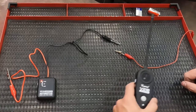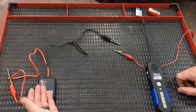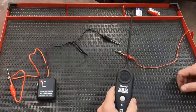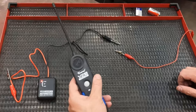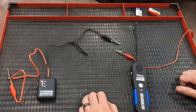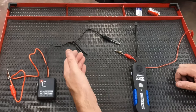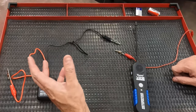This will work through other materials. Say you have a speaker that's not working and one that is working — you can use the known-good circuit to trace the wire in your vehicle so you know where the wire goes. Then go back to the bad circuit and do the same trace, because the wires run together through a wiring loom. When you hear the tone stop, you know that's about where your break is — usually a cut wire, a break at a harness, at a plug where pins come out. Once you find generally where the break is, it's fairly easy to identify. It's finding where it is in that whole sea of wiring and engine compartment and behind all the plastic interior that's the challenge.